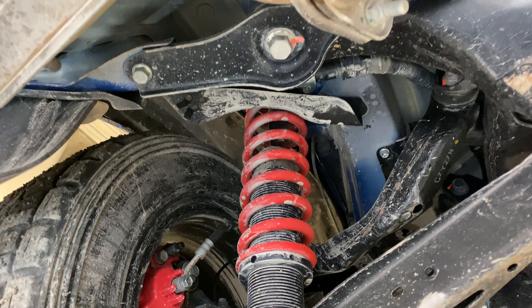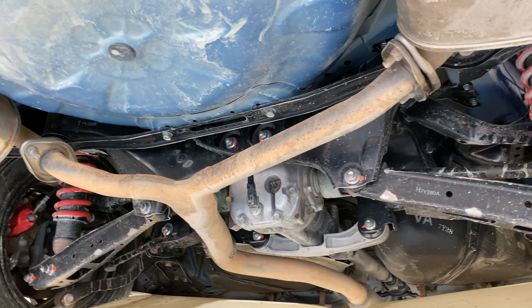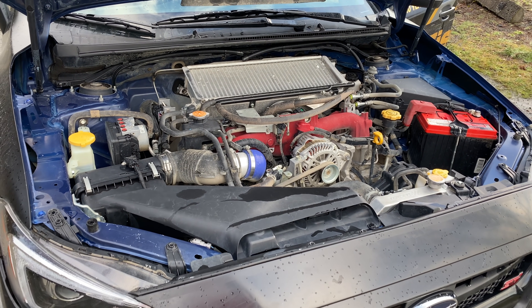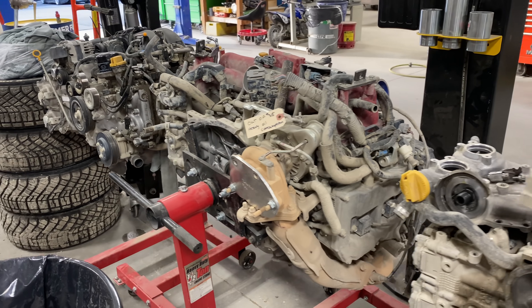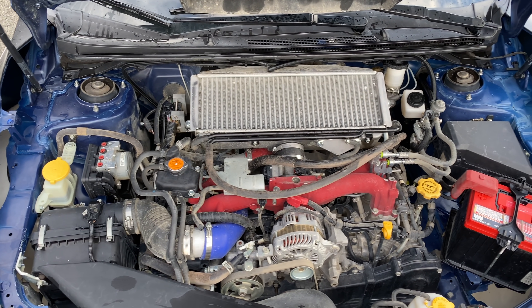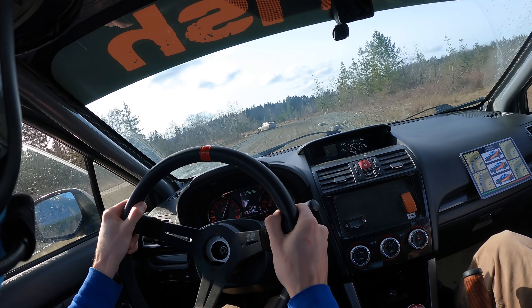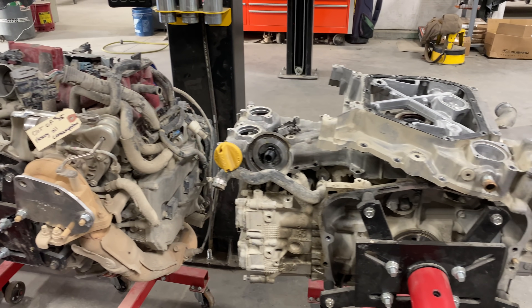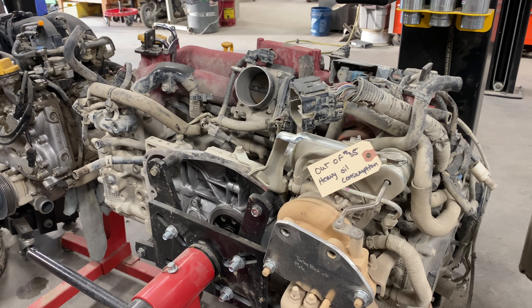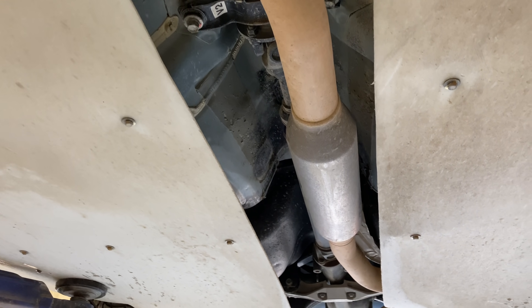Moving inward from the suspension, it's a fairly stock setup for the powertrain before reaching the engine. The transmission and differentials are stock, without coolers, and for the most part able to handle the abuse. Getting to the engine, there are some significant revisions: forged internals with new pistons, rods, bearings, head studs, and head gaskets. The engine is also modified to make it easier to work on, removing certain hoses and emissions equipment not required for a private driving facility. The biggest challenge is the air filter — driving in dirty, dusty conditions means whatever gets past the air filter ends up in the cylinders, chewing up the cylinder walls and eventually making the cylinders oval in shape, leading to excessive blow-by and oil consumption. Following that, there's an aftermarket downpipe which gets rid of the catalytic converters, but the silencer and mufflers remain stock — that helps keep the neighbors happy.